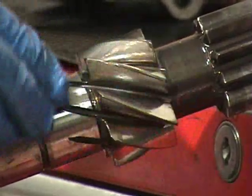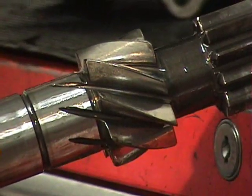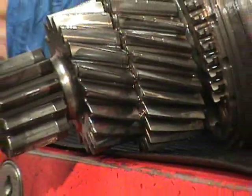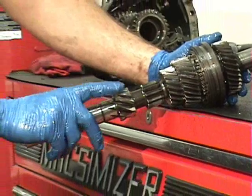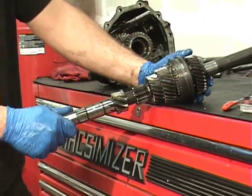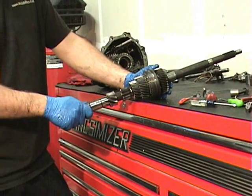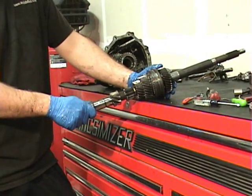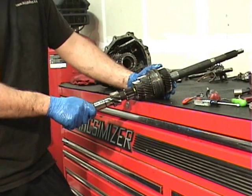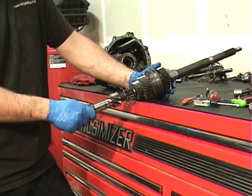There's no deep pitting in the gears, and this is one of the gears that shows at first gear. And you're going to want to look at all the gears. This tranny actually looks in really good shape, so this one should be fine. Just the rebuild. It's pretty rare, like I said, and it's up to you. If your gears were quiet, it's ultimately your call. You drove the car before, you're going to drive it after. If you're going to go road race it for a whole season, 30 minutes, 40 minutes at a time, really beat the heck out of it, then yeah, you might want to look into changing any shafts or gears while you're in there.